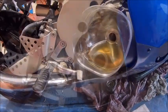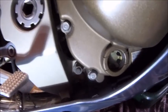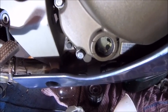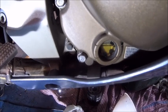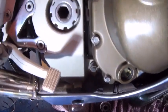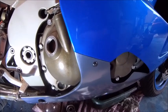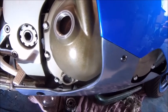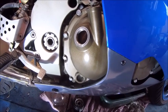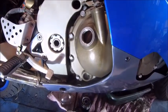Two hands needed. She had about three and a half litres. As you can see on the glass there's nothing showing at the moment, but if I pull the bike up and level it off, it's pretty much on the top mark — that's about where you want it. A little bit over at that point won't matter too much, because starting the bike will fill all the oil ways and fill up the filter, so the level will go down slightly.